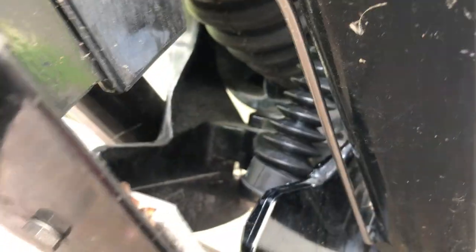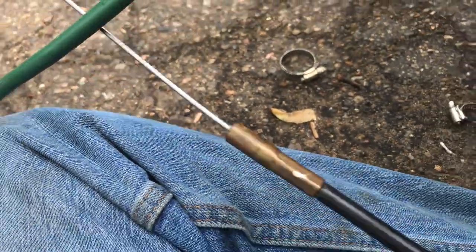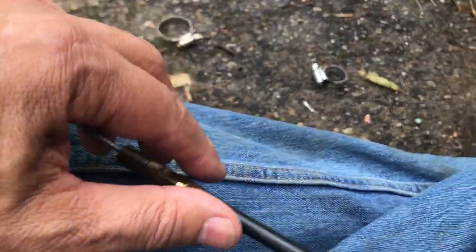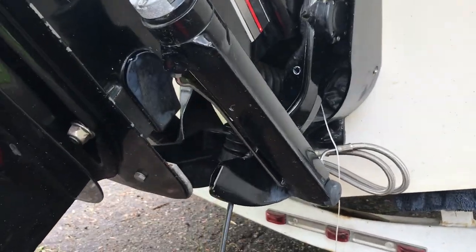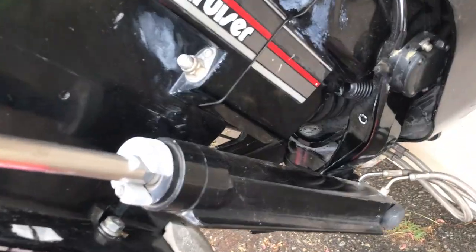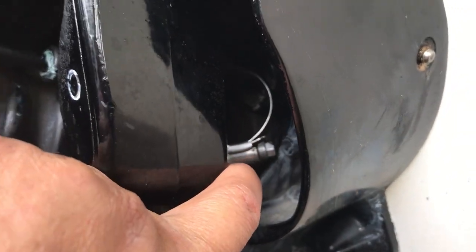I slid the bellows on and — I've never seen anybody on YouTube do this — that hole in the top of the fitting is really small. A lot of people grease and oil it, but what I did was heat up a cup of water in the microwave, got it really hot, put a little green grease on the end, and slid it on while it was hot. That really expanded it so I could roll it on. I pushed it all the way up, now I'll put the clamps on and hook it up to the string to pull it through. I'm filming on my phone so I don't have a third hand — that's why I'm showing it this way.